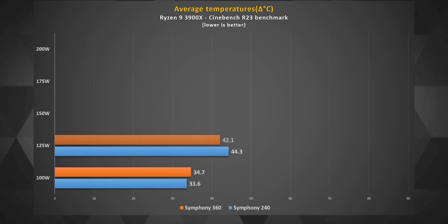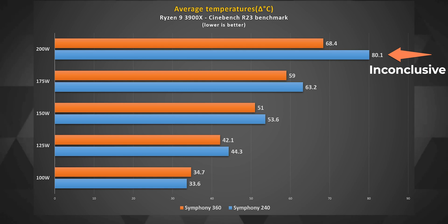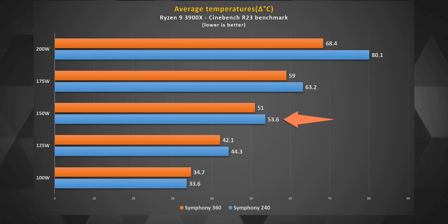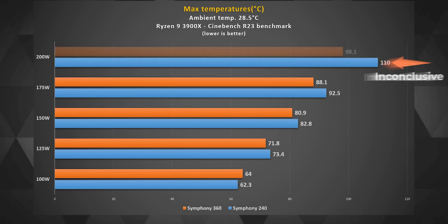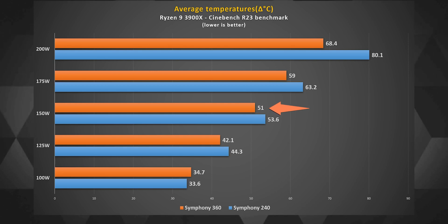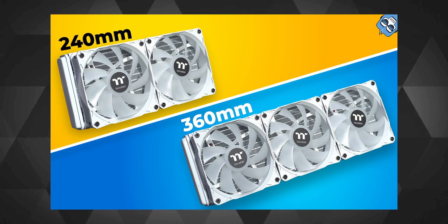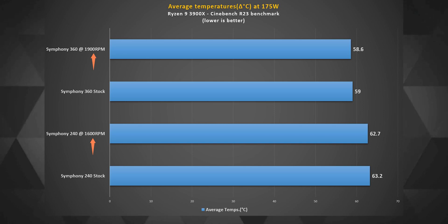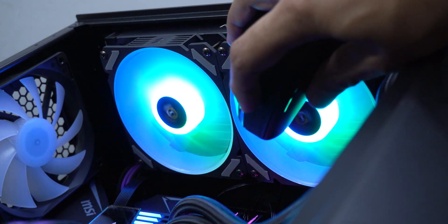When it comes to performance, both AIOs perform darn well for the price. The test couldn't be quite conclusive at the 200W mark for the 240mm AIO, but it performed well at around the 150W mark. Anything above 150W will be a challenge for the 240mm AIO, especially without AC in a warm room. The 360mm AIO option is more viable and handles chips producing heat around the 175W mark. It was nice to see a good difference between these two sizes, unlike my experience comparing same-sized AIOs by Thermaltake recently. Pushing fan speed to 1600rpm manually improved temperatures slightly, though the motherboard should have kicked that itself. The fans on both AIOs don't produce noticeable noise, which exceeded expectations.